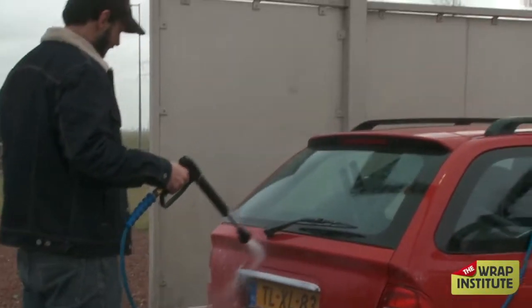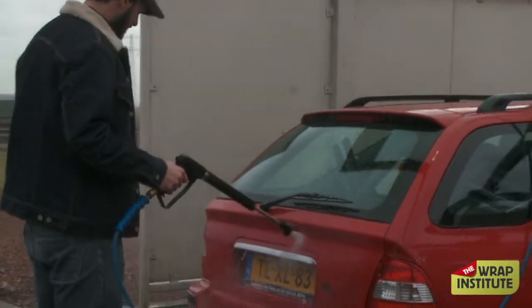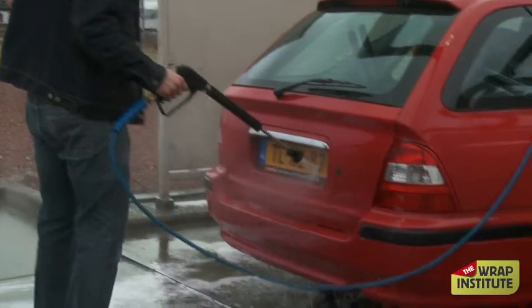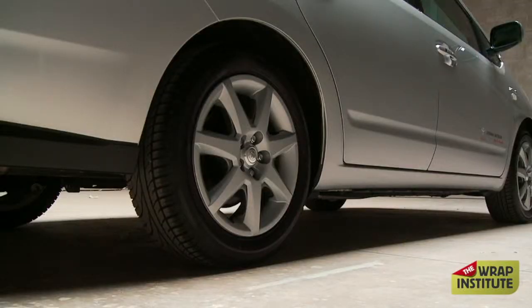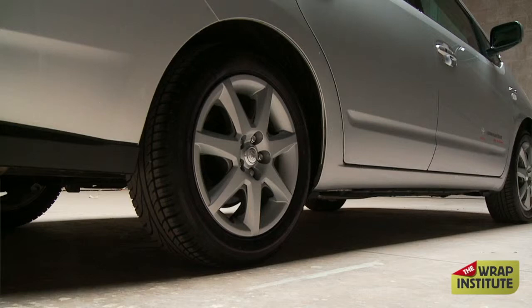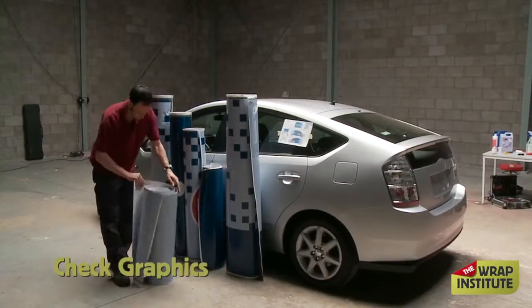Always the day before, because that allows the water to properly dry inside areas like around the license plate, back lights, all that kind of good stuff. If the wheels are shiny when the vehicle shows up, that means they had some kind of protectant put on them — and that protectant is always silicone-based, oil-based — and that will spread along the whole side of the body. So just make sure you pay particular attention to cleaning and degreasing that area.